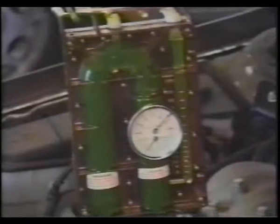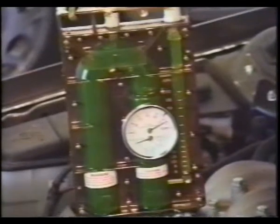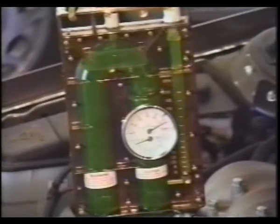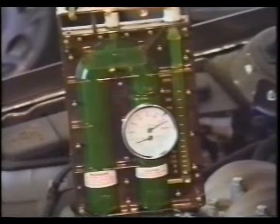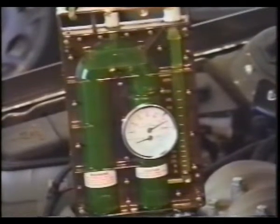Test number 1. Thermostat. Stuck open or no thermostat. When the engine is first started, the ball of the flow meter will immediately start to register gallons per minute. The gauge on the analyzer will also indicate a temperature considerably below the normal thermostat opening temperature. Thermostat stuck shut. Lack of circulation will cause the engine to heat up quickly, and the gauge on the analyzer will soon indicate a temperature above the thermostat rating. There will be no GPM readings at any time.